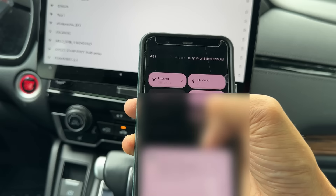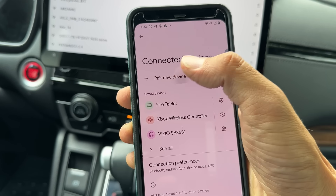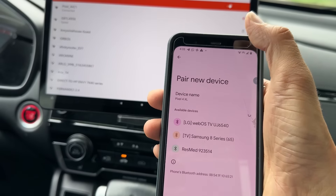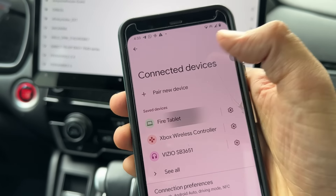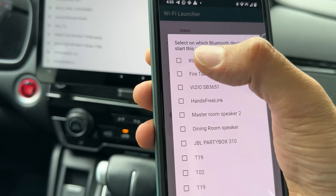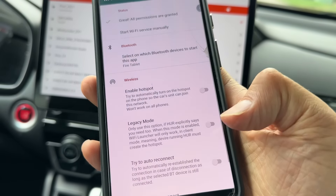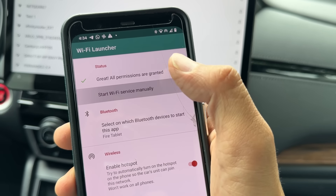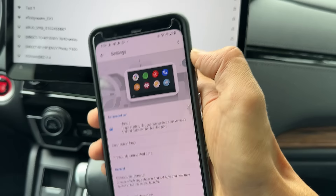Next, we need to connect Bluetooth from the Wi-Fi Launcher app to the tablet. Swipe down and tap and hold on Bluetooth, then tap 'Pair new device' if you don't see your tablet. The tablet name in Bluetooth will be 'Fire tablet' or a different name. Connect to the Bluetooth on your tablet. Then in Wi-Fi Launcher, hit Select and choose your Fire tablet. Hit Okay, and then hit 'Start service manually'.